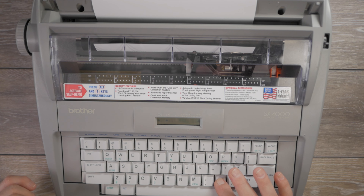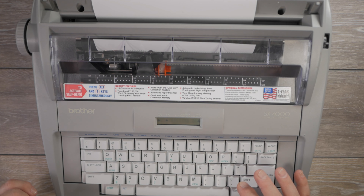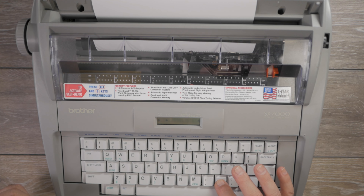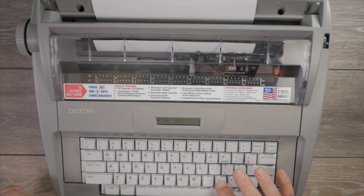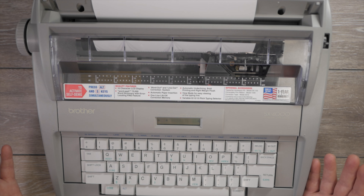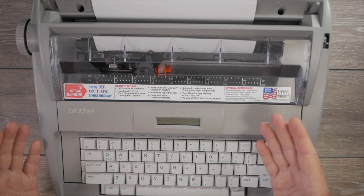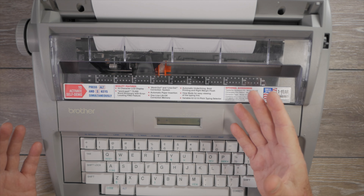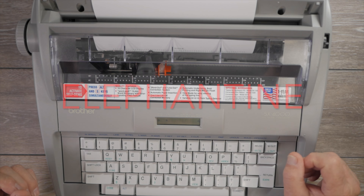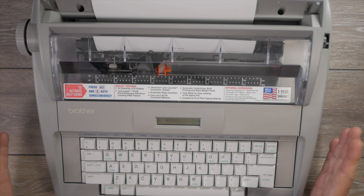In the hot zone, when I type a space it automatically does a carriage return. But if I don't type a space while in auto mode and keep typing letters, when the margin beep comes it will just stop and beep — you'll have to do a manual carriage return. Auto mode is really looking for spaces between words, so most words are short enough that you'll get a space somewhere in the hot zone. For very long words, you may have to do a manual carriage return anyway.